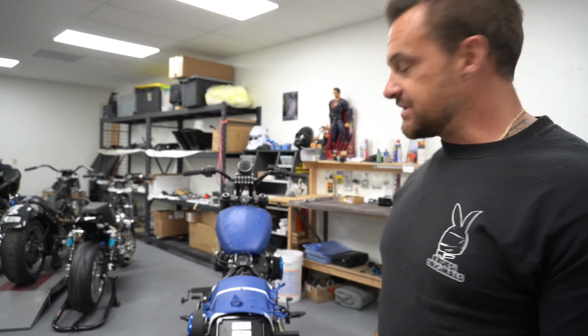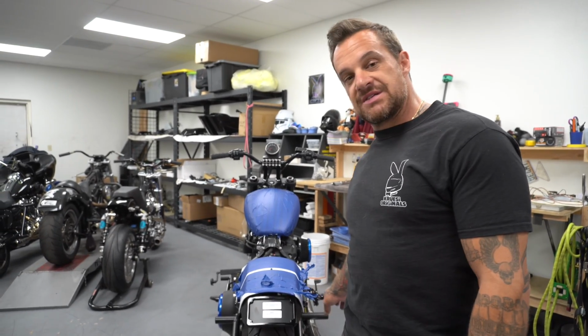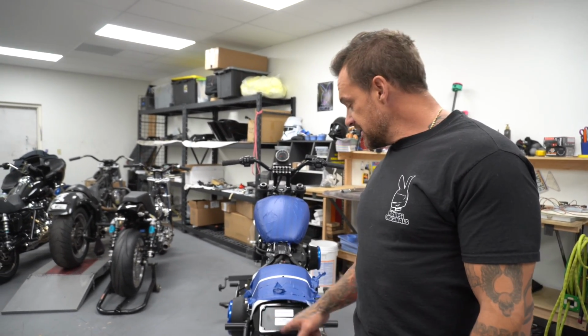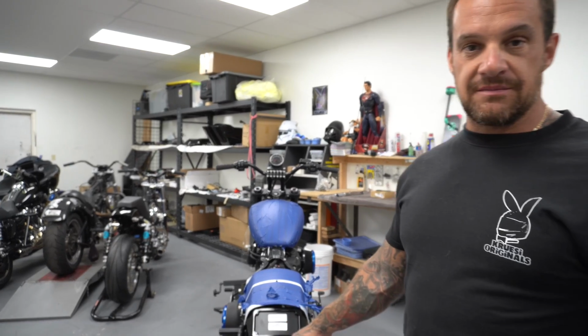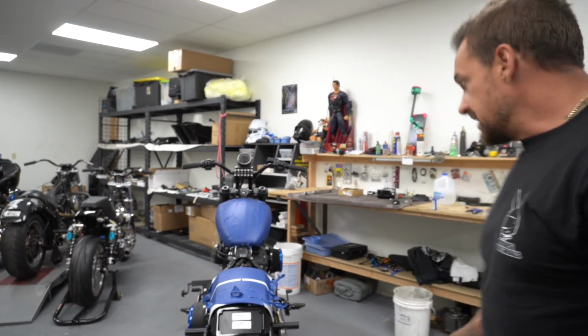This guy right here will be available on our website as soon as this video is done. I think Trent's working on it right now. It's really easy to put in. If you're just going to run it as no tail lights, most guys have the blinkers out here, so you don't need a tail light. It's two wires, just a hot and a negative. You just run it to ground. It's a running light. That's easy to do. I'll show you how to do all that too when I get to it.